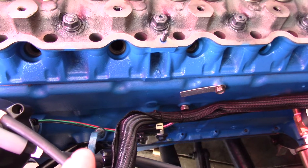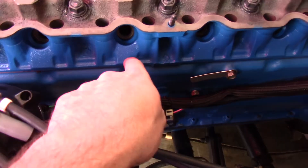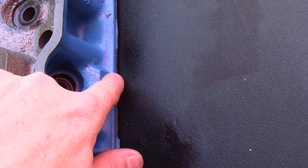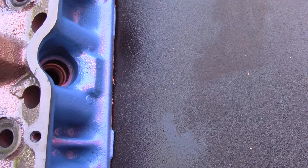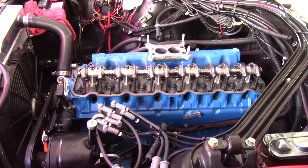Interesting observation here — I'm curious if Ford did this for a reason. This D8, '78 head doesn't have any relief — it has a lot of meat from underneath the spark plug all the way to the edge. The coolant passages are at every single spark plug hole — that little triangular passage is right here. Now look at this '69 head — see how the relief cuts short and doesn't go all the way to the edge? I'm wondering if Ford did that because they were having problems with these leaking. If there's more meat here it's less likely to warp in this area. It's a definite design change from the earlier head.